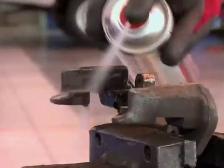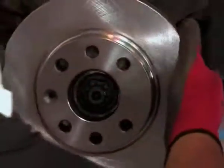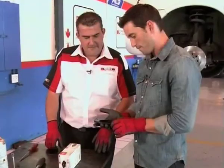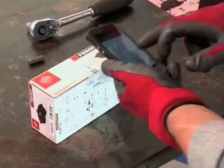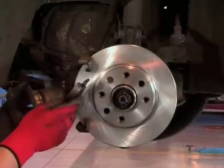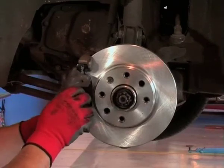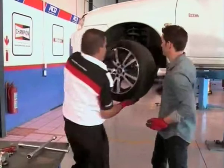Clean the disc with a solvent-based brake cleaner to make sure there is no oil on the contact surface where the pads need to run. Repeat the process for the cradle. You can then start reassembling by fitting the disc on the hub. Before you fit your pad, you can check the authenticity of your Ferodo product by downloading the app from ferodo.co.za — just scan the QR code on the box to make sure it's not a counterfeit. Then fit the inner and outer brake pads, then the wheel, and you're done.